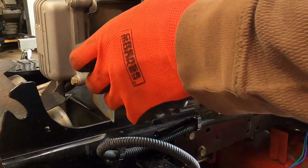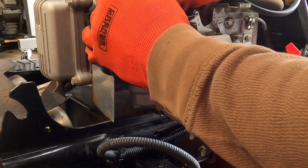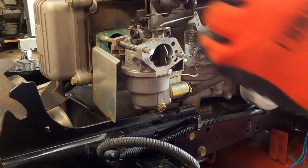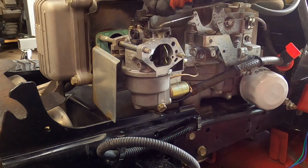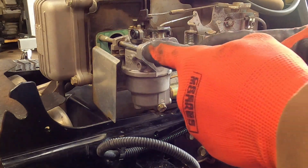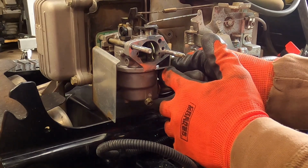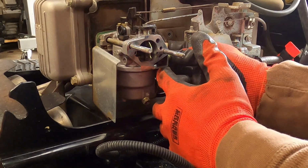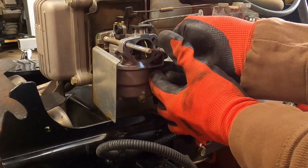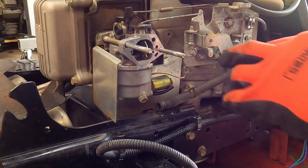And we come up here, we can do the same thing. Finagle the throttle. You guys can't see me. Just finagle the throttle, and then you've got your anti-surge spring right here. Stick that down in the hole that's provided. Slide it on. Make your connection for the hot side of the fuel anti-backfire solenoid. Just clip it. Got her clipped in there good and secure.